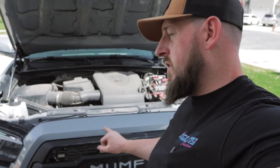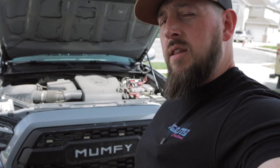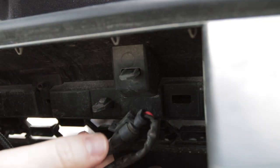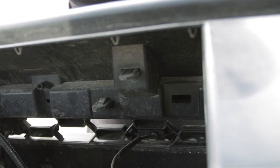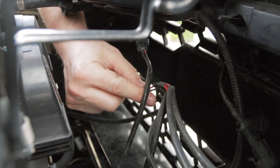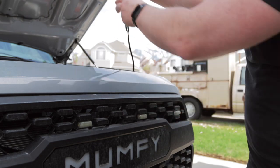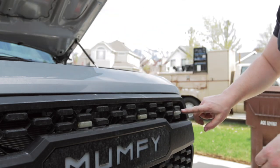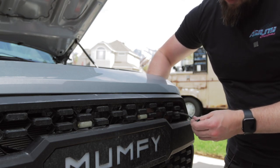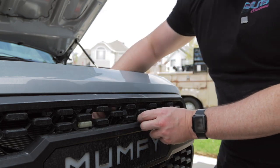First I've got to cut all of the zip ties holding up all the wires behind here, and then I'll be able to pull these lights out. Now I can start unplugging each of the grill lights' power, and then that'll give me access to the main power right here. I'll splice into this power that's already being run. Once you've unplugged all of the wires, you've released all your grill lights — they should just push out through the front and you can wiggle them out and toss away your old lights.